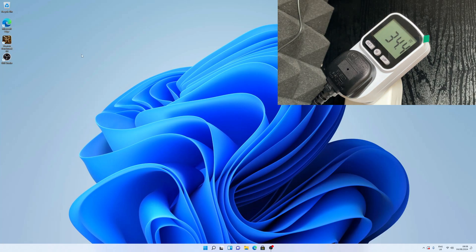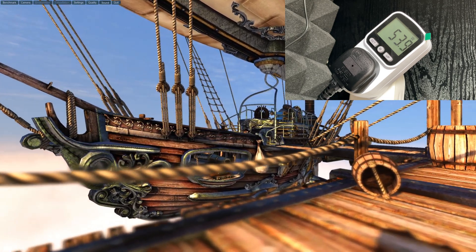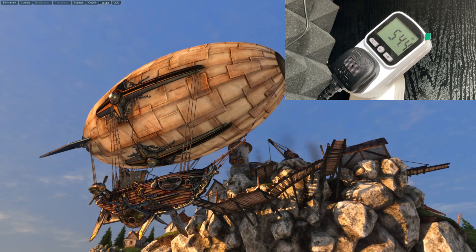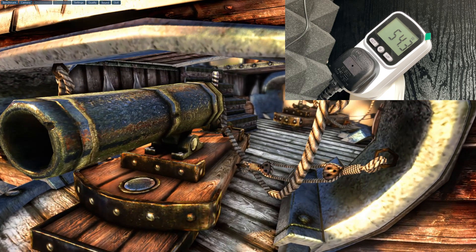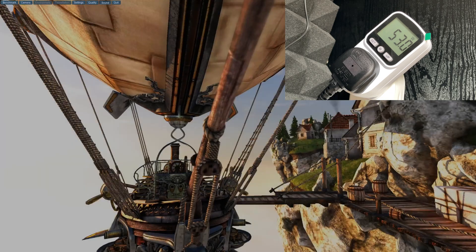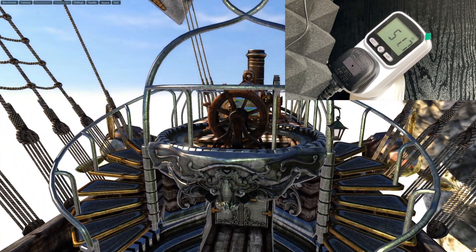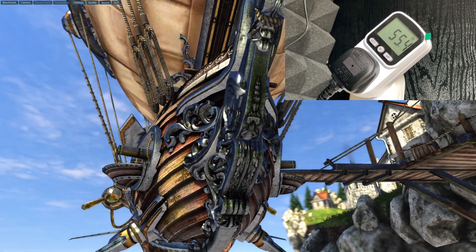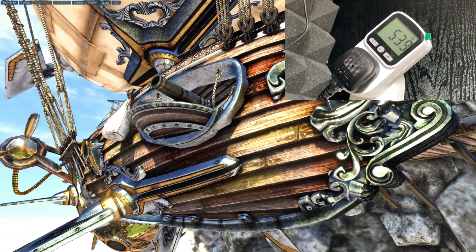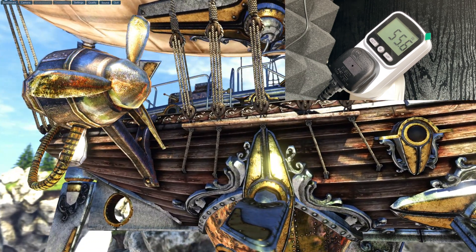Before benchmarking begins I start recording on OBS, and the power draw is sitting at about 33–34 watts — between 30 and 40 watts. I've fired up the benchmarking program so the frame rate will drop a little because the machine is being stressed to the max. I don't really care about the benchmark results themselves — it's more a way to max out the CPU and absolutely stress this machine so I can see what the power draw is when the CPU is at 100%, RAM is being filled, and the graphics unit is being used. I want to know the maximum this thing will draw from the wall, since I'm planning to run it as a server — plugged in 24/7 under high loads.